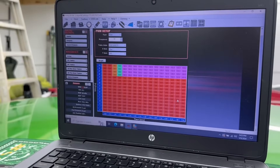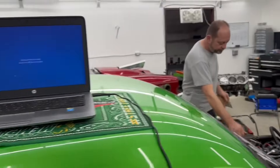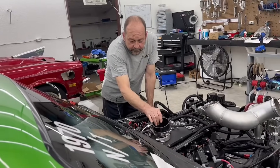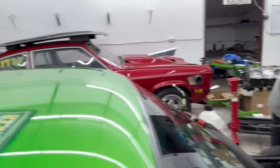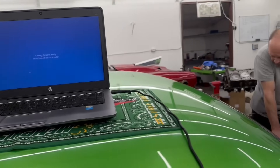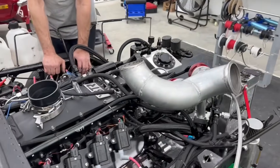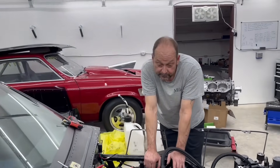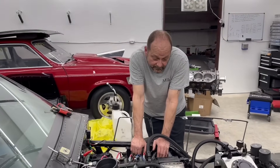Maybe I didn't hold it seven and a half seconds. Alright, as always ECU stuff is fun — we got a Windows update and it said you're doing the update now. That's what it did. We were going to show the advanced table too — we'll add fuel when the nitrous output is enabled through an advanced table. Also, we just figured out why the solenoid was staying on the whole time: the way I did the table at seven and a half seconds, I thought it was going to stop, but no — that's an infinite loop. It goes on forever at 100%.